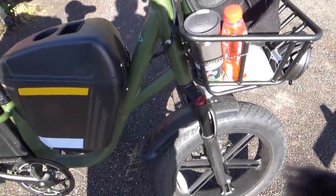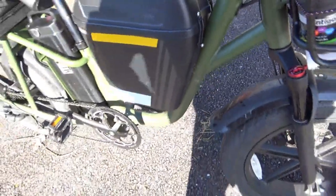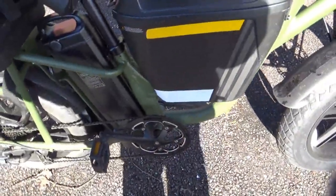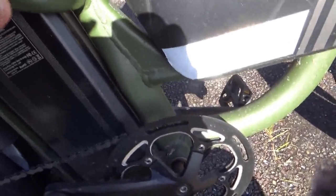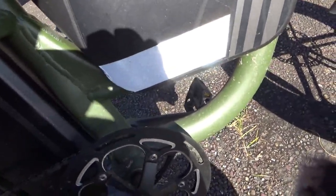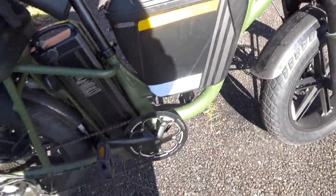Moving back on the bike — the Fido with the frame replacement. They claim to have put in three walls inside the tube here to reinforce it and stop the breaking that the original T1 used to experience along here. My one didn't break, so I sold it on to a friend. In doing so, they changed the profile of the bike a little bit — they had a reinforcement stub welded in here, which is good, but the crossbar that goes across here is about an inch lower than the old one. This gives the whole bike a slightly lower center of gravity. This meant that fitting this Rad Runner box here was a bit tougher, because you have to take a blowtorch and melt the bottom floor to get it to fit the new profile — it's not as handy to fit as on the old T1.